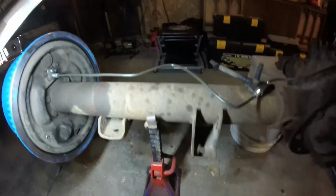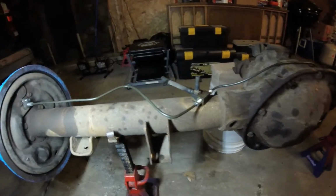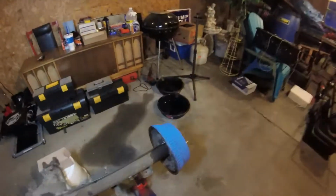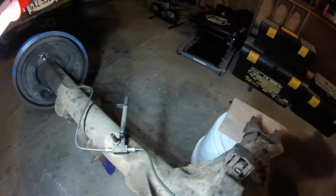And it just does that zigzag right there, which is to keep it away from the shock and allow it plenty of room to bend and go into that fitting, the block fitting, and that's it. Runs up over there, sits well above where the U-bolts are going to be, and that's all it is. Brake lines are pretty easy. I was kind of afraid of them at first, but pretty straightforward to do, especially if you get new fittings and a good tool to flare everything with.